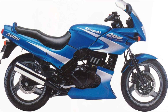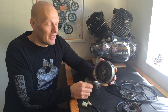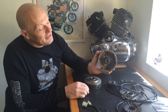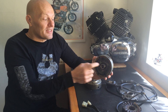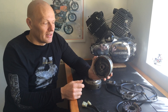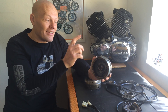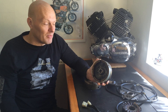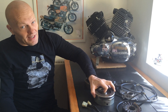You might then think: can I use the flywheel? Actually the basic flywheel is the same, but the Japanese do things a bit differently. They mount the flywheel on the crankshaft with the stator coming from the outside in, so the taper is turned the other way around. Unless you can find someone to make you a new inner part, you can't use the flywheel. And besides that, they are sought after in the Kawasaki community as well, because they have the same problem with magnets coming loose — probably more so because it runs a bit hotter in the Kawasaki. So again, take good care of it.